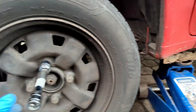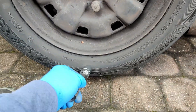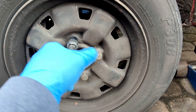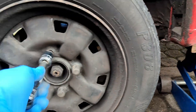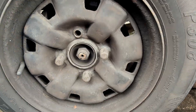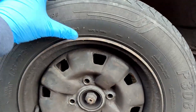That's it jacked up. You want to loosen these first while the wheel's on the ground, because otherwise without the weight of the vehicle, if you try and loosen them, all that will happen is the wheel will spin. So loosen them first, then jack it up, and then you can take the wheel bolts out completely.